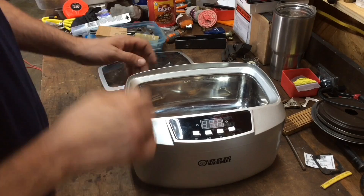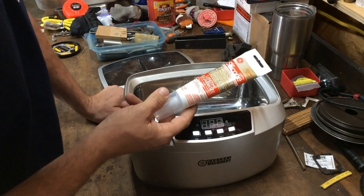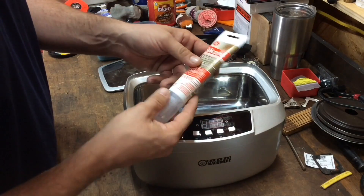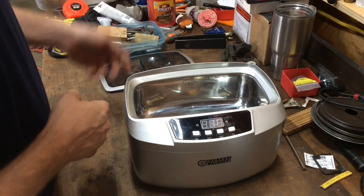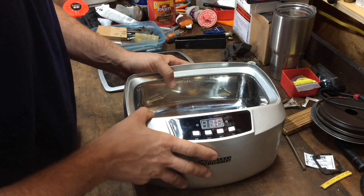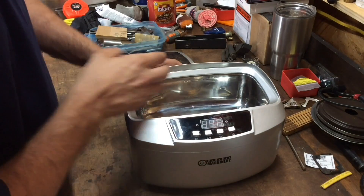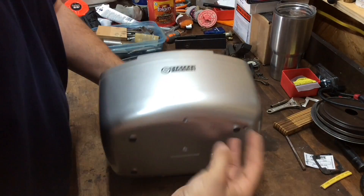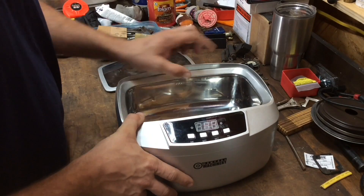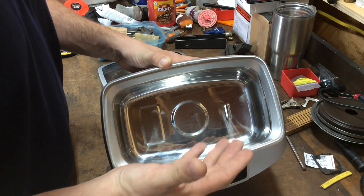So the fix is silicone caulk. This stuff doesn't shrink, doesn't crack, won't break down, won't wash away, and won't yellow — it'll look good pretty much forever. You don't have to use this specific brand or GE's whatever number this is, just get some waterproofing silicone. There are two places you can improve it. You can take it apart — there's a board down here with four connections you have to undo, plus a connection to the panel that goes to the bowl — and then silicone the joint between the bowl and the housing on the inside.